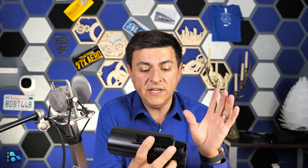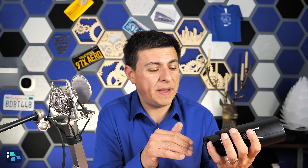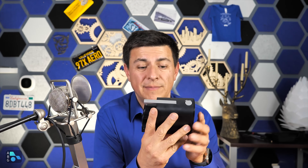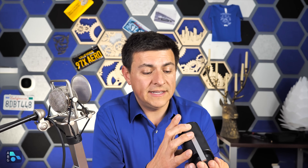We ran the cheap knockoff through the electron microscope and did some EDS on it — it is plated with tin, whereas the Electron adapter is plated with a high percentage silver coating, which is going to be more conductive. According to this adapter, it's rated for 1000 volts and 500 amps. The amount of time it can spend at 500 amps is going to be dictated by the exact resistance and how hot it is outside, and whether or not those pins end up overheating. But in our testing, even in a relatively low voltage EV like the Blazer EV — which has a really low voltage battery pack and as a result spends quite a lot of time at 500 amps — it was completely fine with the Electron adapter and completely fine with the GM Tesla adapter as well. There is nothing unique about these adapters, and because there's no logic inside, in my opinion it really does not matter exactly which one you use as long as they are constructed really well.